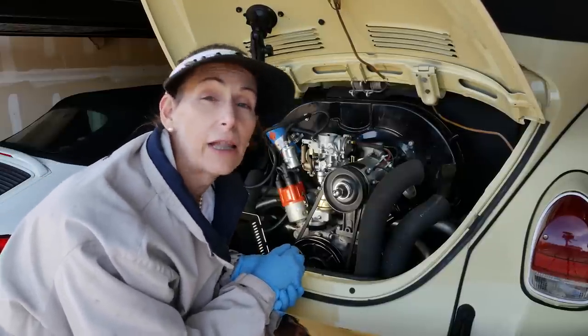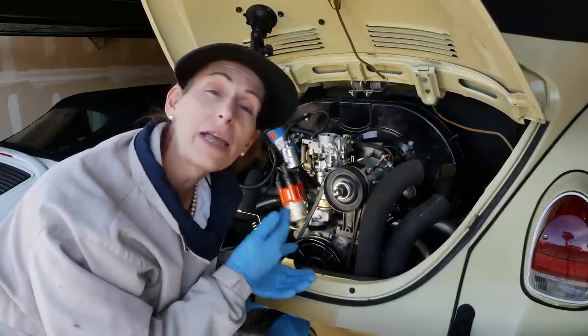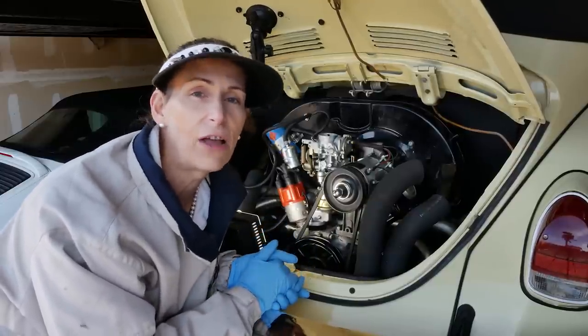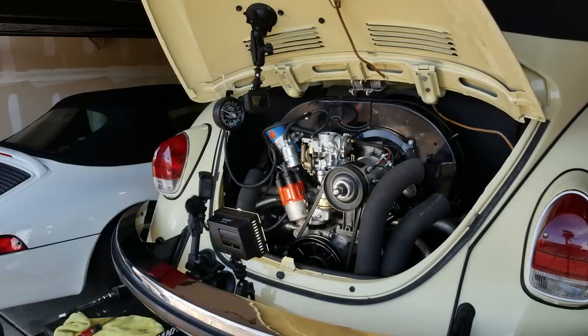The pressure regulator will roll the pressure down, or you can set it to whatever you want it to be, but it will keep the flow constant. And that's the key: we still need that flow, but we need it at a lower pressure. So hang on just a sec.